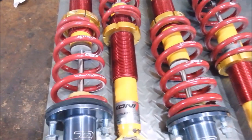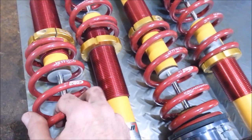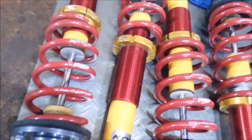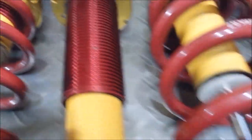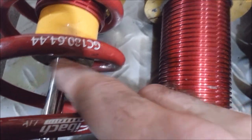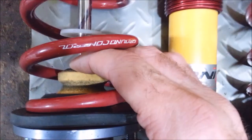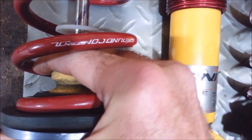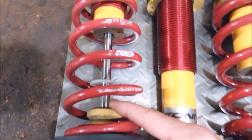These are used, so there are things you've got to look for when you buy used struts to make sure they're good enough. You can look at the date on these — they're from 2013, so about six years old, which is pretty good. The big thing is you want to make sure none of these are leaking — absolutely no oil coming out of any of them. They're all really clean. You also want to make sure the shafts aren't scored up — they look beautiful. If the shafts are scored you'll usually see oil. Make sure the bump stops aren't crushed; if they are, that means the car was slammed and ridden on them. These still have a little tape around them and they're not flattened out, so that's good.